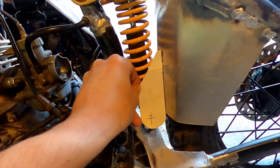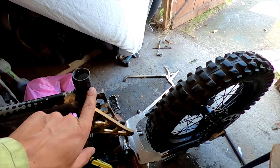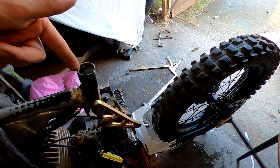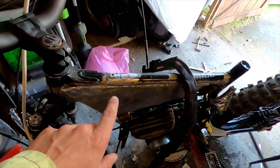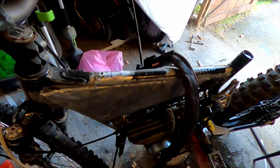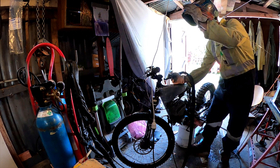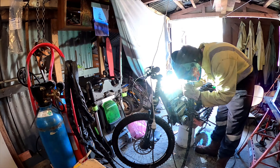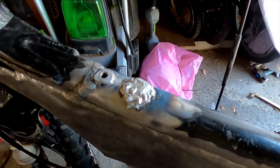Now I need to make a brace - two clevis pieces to hold this. I might make them out of three mil since I've got some left. Since this back mount is gonna be where I was planning to fill up with gas, I'm gonna need to strengthen it up, which probably means making the seat post non-adjustable. I'll pad weld a piece here and then drill and tap a big enough hole to get fuel in the top.